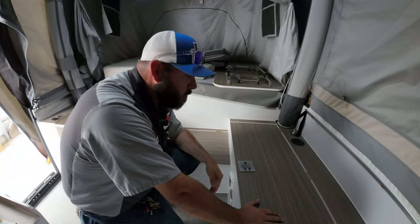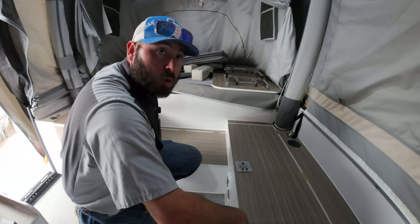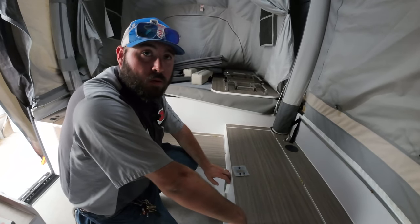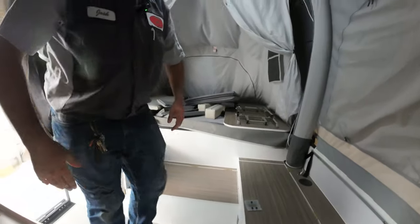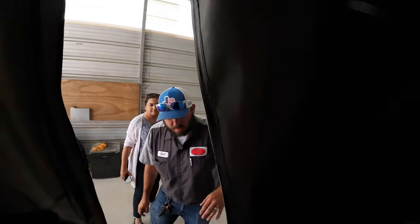The first thing you're going to do is go outside and unplug the trailer from power. The second thing is to kill the power right here at the control board. We want this trailer completely dead when we reinstall this, so there's no power to the board to send it into the test mode that it tries to go into if it has power. I'm going to do that for you. So pretty much turn off the red key? Yes, sir. Just turn this red key off right here. And the thermostat should be dead without power. Yep, the thermostat's dead.